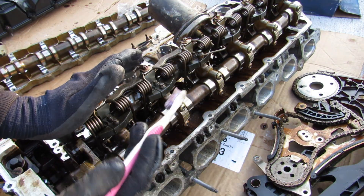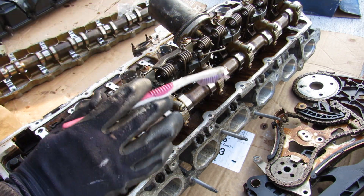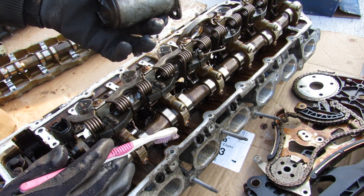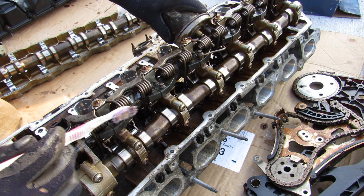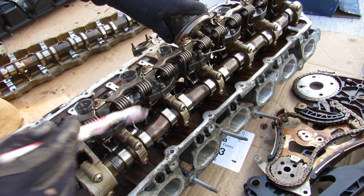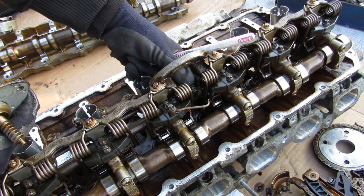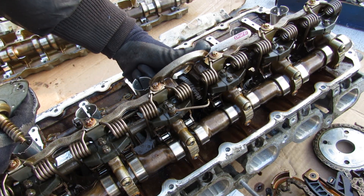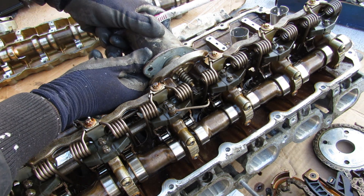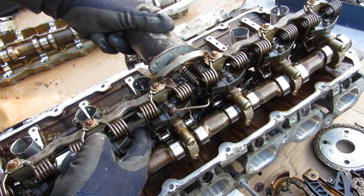The intake does have a backup throttle body in case the system fails, with a traditional drive-by-wire throttle body. But the real motor driving all of this is this electric motor over here — just like a throttle body motor, this is going to turn the shaft at the top here to adjust the amount of lift that the valves are getting down below. You can see this motor has a worm gear on it, and over here on this shaft we have a semi-circular gear which it interfaces with, and as you turn that worm gear it's going to push that over and rotate the shaft.